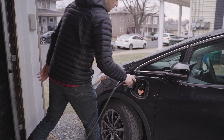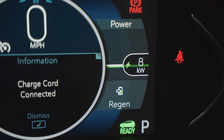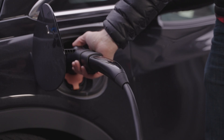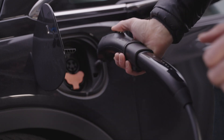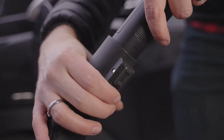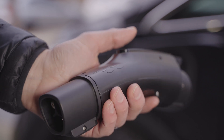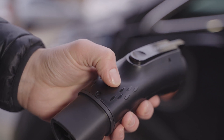So I don't like how the Shockflow handles those connections — it seems like they're heating up a little more than they should. Overall, the unit works as intended. You plug it into the vehicle, you can charge up to 7.7 kilowatts, hit the button to release, and it kills the relay on the Tesla charger so you can remove the unit. The sliding switch works — it's not perfect, but it works to connect to the Tesla end. There are some nice knurls on it and it's a nice-looking design, a little chunky in the hand, but you don't use these things that much so ergonomics isn't a top concern.